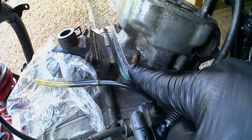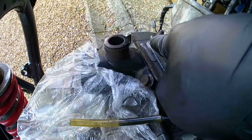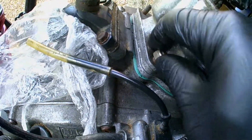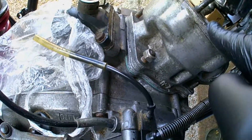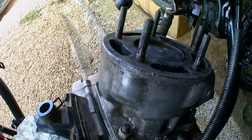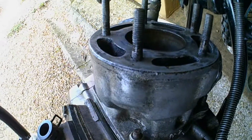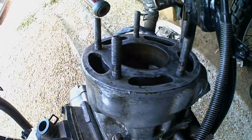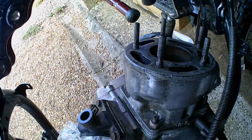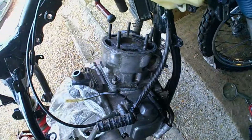I've got some new nuts on order. One of them is supposed to have a clutch cable holder that you can't get anymore, so I found a couple of nuts — I might just be able to hold this down with a couple of nuts and spin it over for a spark test later. I'm not planning on running it with only two bolts holding the cylinder barrel on, but I should be able to gently turn it over. It sounds alright — I'll get some more oil lubrication down there.